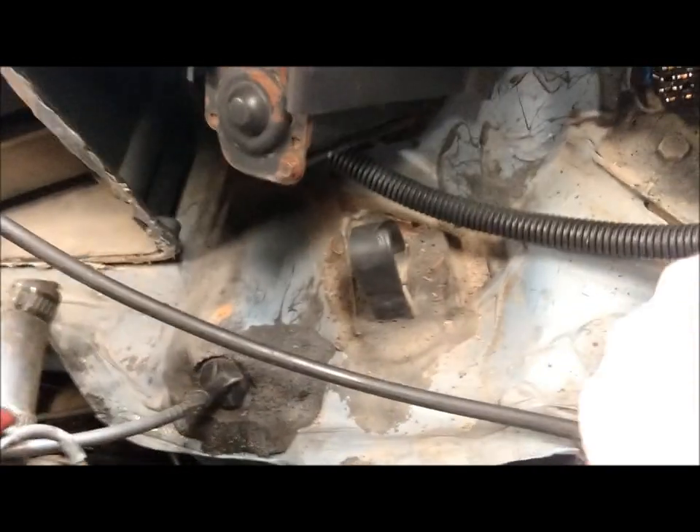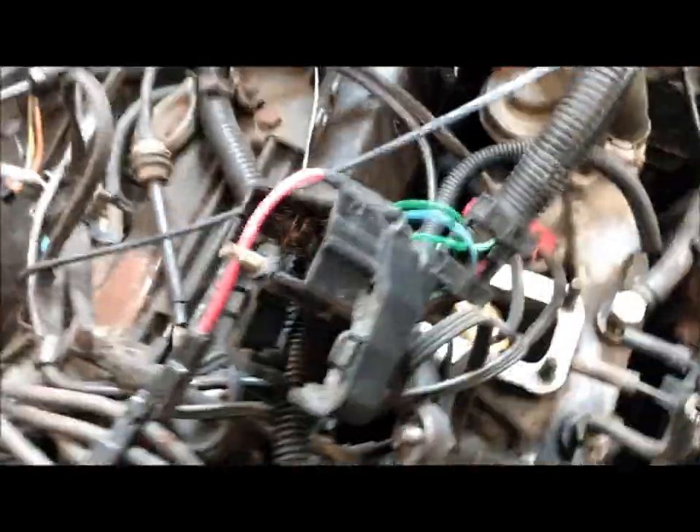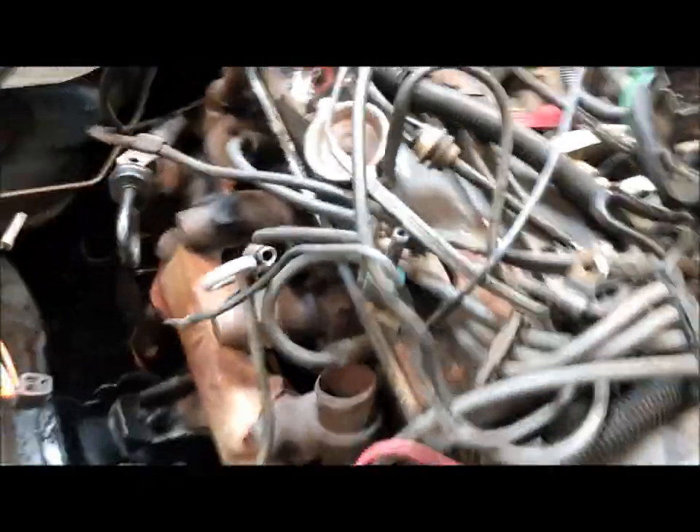When this comes off you can slide one tab out from under the other. If you have an automatic, you'll have a torque converter lockup switch right here — that stays with the harness, hooked by a clip. Flip all of that harness onto the engine so everything is one piece — you don't have to do anything underneath. Take your two 13-millimeter exhaust bolts off with a long socket. Make sure you soak everything before you do this so you don't risk twisting off any studs.